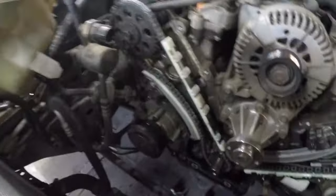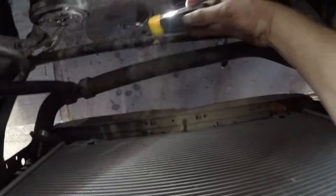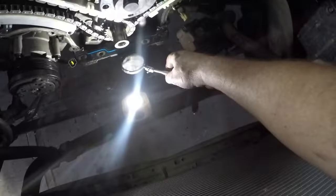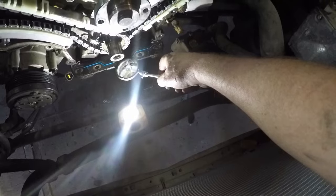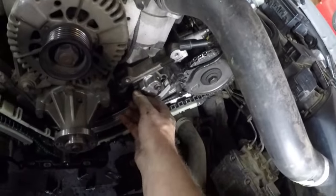They have the tensioners installed. And I'm just going to double check again. Black link on the dot. Black link on that dot, and same here underneath. Put that there, and look under here, see the mark, black link, and the black link behind that as well. So the timing's right. I haven't pulled the pins yet, so I'm going to pull the pins right now.